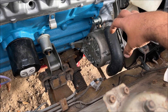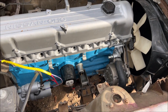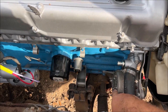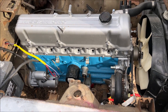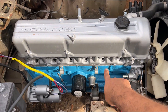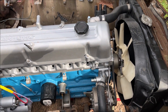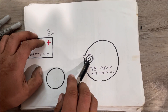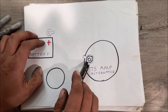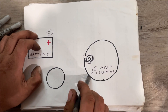This appears to be wired exactly like a GM 3-wire — we have an exciter and a voltage sensing wire. It's this simple: it connects right there to right there, that's your charging system. You do have one 18-gauge wire that runs back to the key switch to excite the alternator. Let's draw a wiring diagram and wire this thing up. Alternators are going to have a threaded stud on the back — that's where your charging wire goes. I call it the lug.